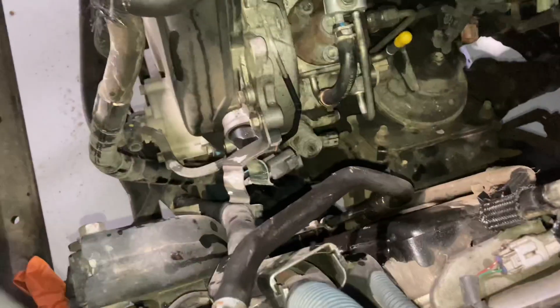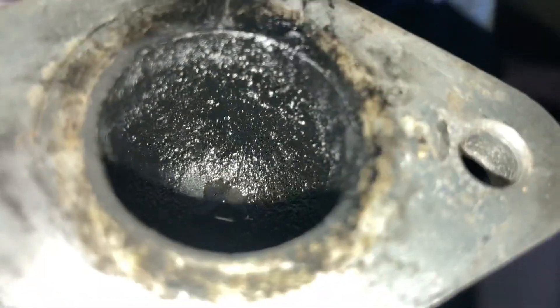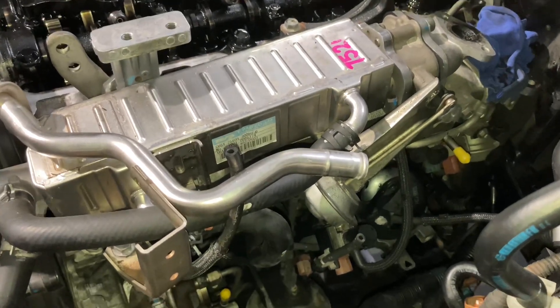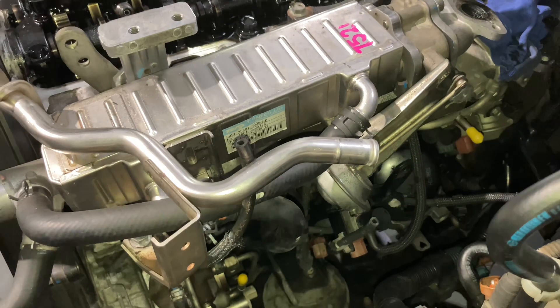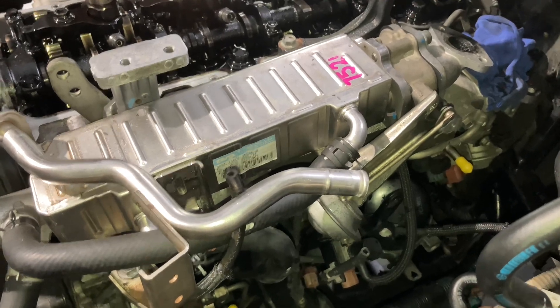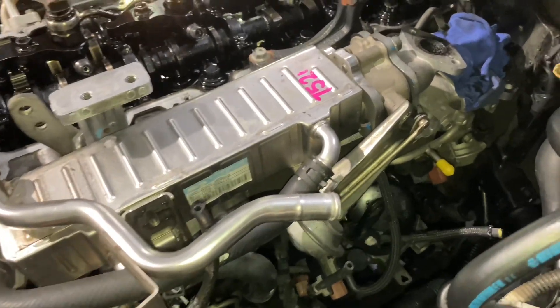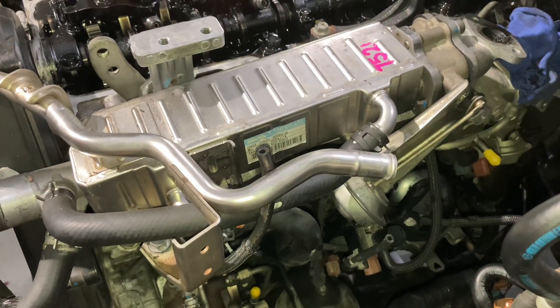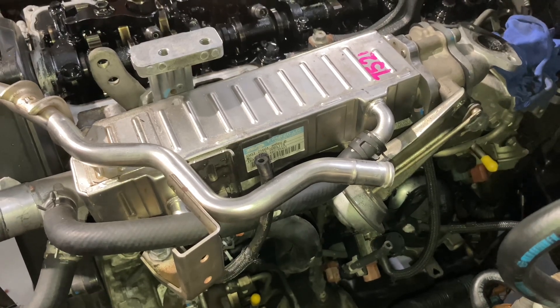The engine has had a bit of progress — most things look fairly disconnected. There's a drop of coolant sitting there. This one had a problem with the EGR cooler previously and it got cooked. For people saying 'you cracked the piston again' — you've got to understand it had a coolant leak, no coolant left, and the coolant temp got up to 120–125 degrees. That's a contributor. There was an internal leak in the EGR cooler — very rare, but he double-checked and definitely confirmed it.